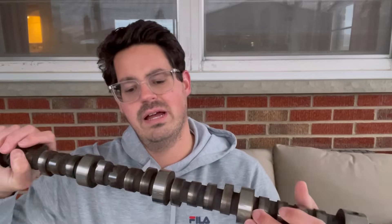So, yeah — soft camshafts. And again, this is a camshaft from a car with only 25,000 miles on it. Beware when you buy some of these malaise-era vehicles. I would say this issue kind of occurred from the late 70s to early 80s, more or less, with some degree of frequency. Before that and after that, they seem to have fixed it. But this Pontiac camshaft from an engine that I think had close to 100,000 miles on it — camshaft's fine, no issues. Although Pontiacs did have that issue too — they did have some issues with that even before the late 70s. So, something to be careful of when you're looking at cars. Make sure they run well, especially if you're buying a malaise-era vehicle. In any case, hope you enjoyed that porch chat. Thanks again for watching, and until next time, take care.